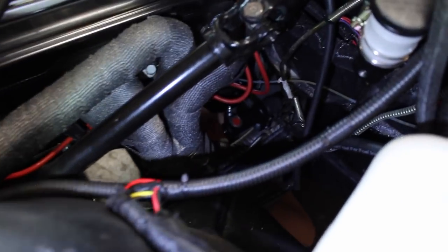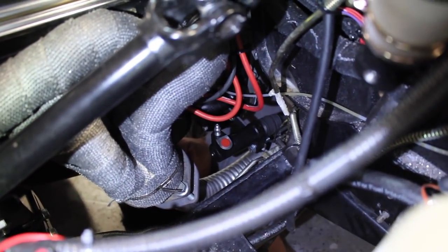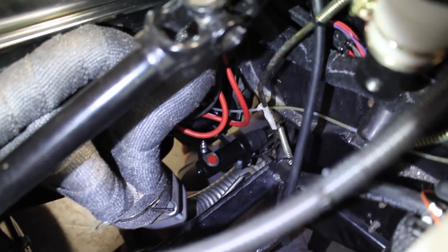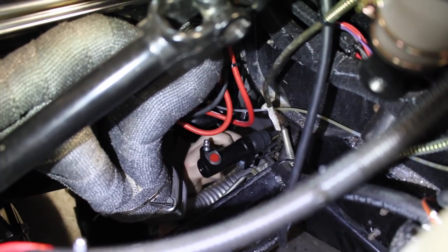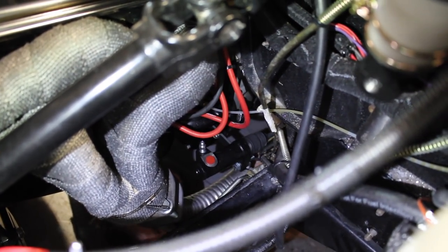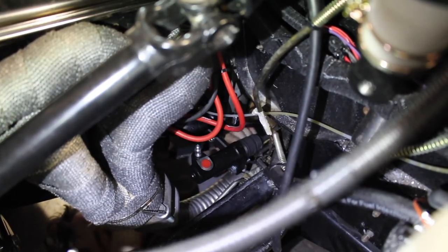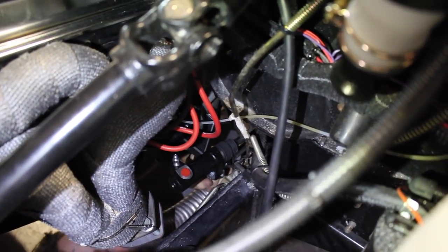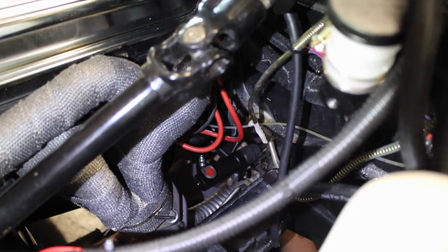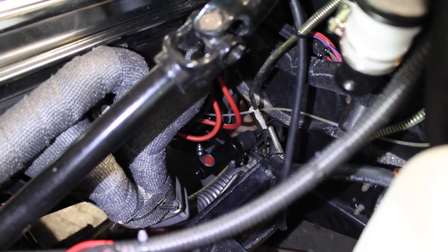Cylinder there, and then you can see the slave cylinder right there. So we have that one horizontal bar right there. This guy is held on with just a quarter-20 bolt right now. Its purpose is mostly for alignment, but it'll also give us a little bit of extra strength. Then we'll weld this piece of metal to this stock mount, and that'll give it another support, because we want it to be nice and stiff. Once it's all welded up, we'll give you a shot from under there. It's really tight, so we'll just wait.